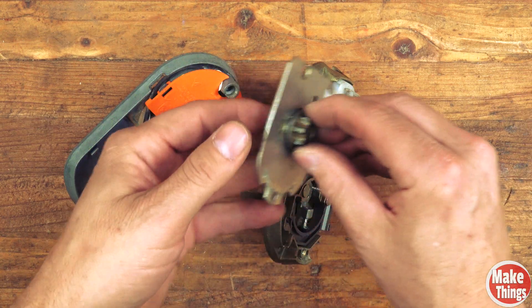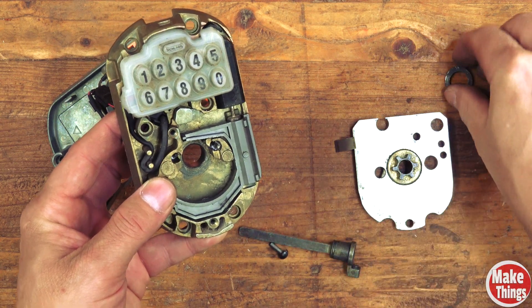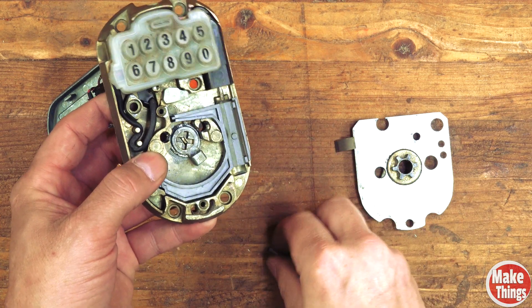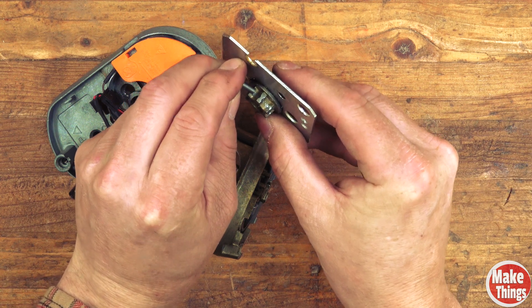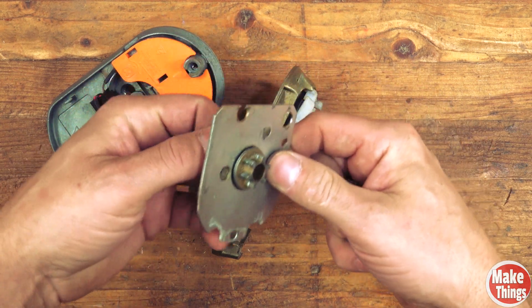Doing that damaged this interconnection and the lock will spin several times before it locks or unlocks the door. Each time I have to put the passcode in or hit the lock button, and usually the optimal time for it to fail is when I either have my hands full or it's pouring down rain. The way that I fixed this a couple years ago was I added a small washer — I took out this piece here, slid the washer inside, and put it back in. This lifted the little shaft so it would go a bit higher and not hit those chewed-out marks. But it's getting so bad now that I'm going to have to replace this ring altogether or buy a new lock.